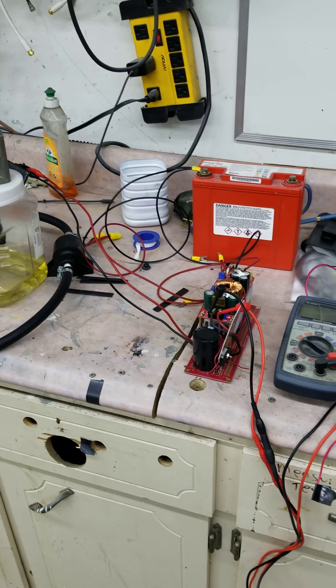I have a solid state fuel pump right here. These injectors get cooled by the fuel — they have to have fuel flowing through them. That little pump is circulating cleaner. I'm going to use different cleaners; right now this is straight Sea Foam. When it's going through the injector constantly, it's cooling it when the injector starts to be activated.